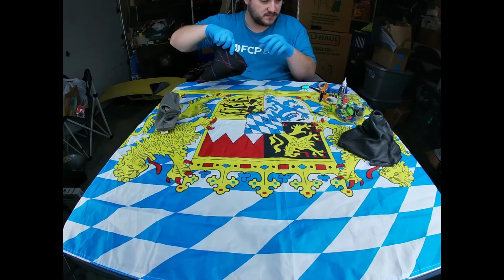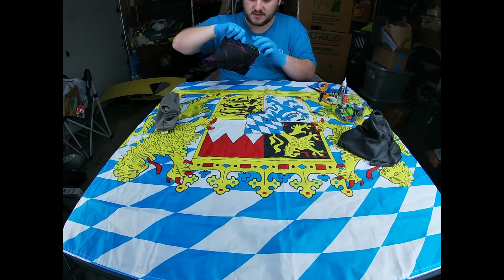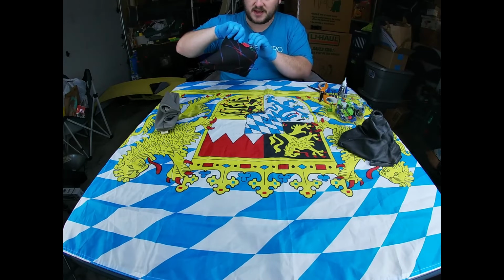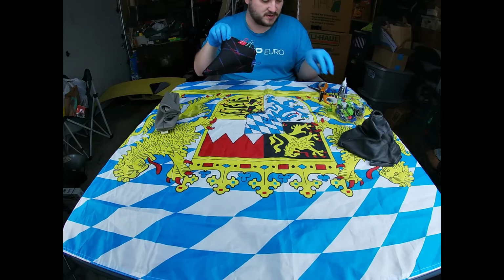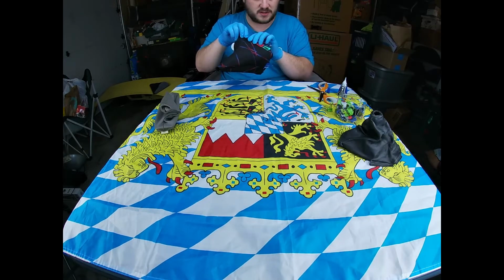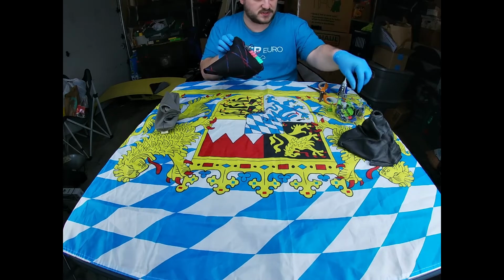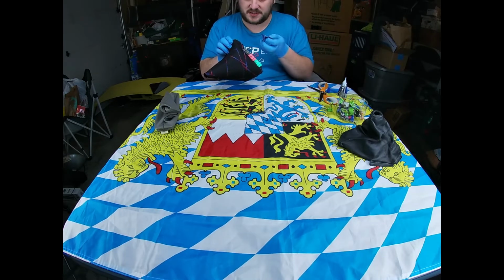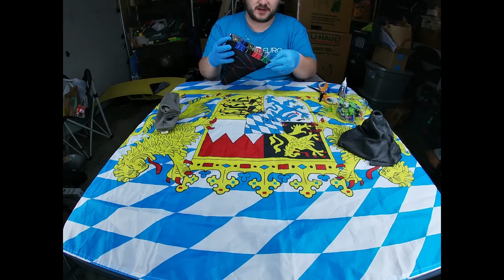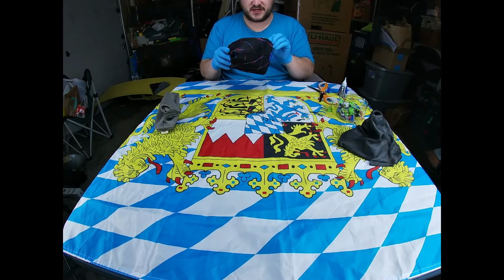So then, when you get that glued, you're going to put the binder clips on. You don't have to have them exactly touching or butting up against each other. Just make sure they're somewhat close, so you get good coverage and good pressure on the spots you're gluing. It'll look like so there. And you can actually work on the other side if you want.